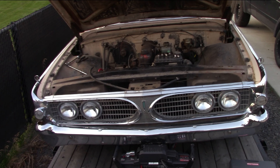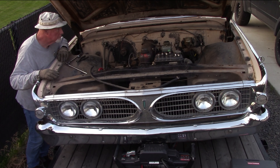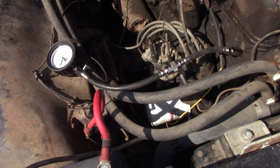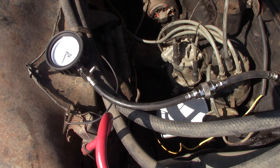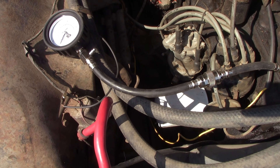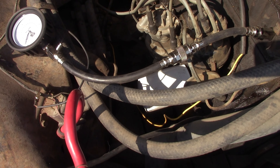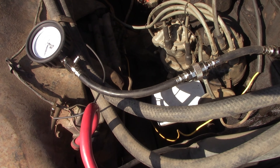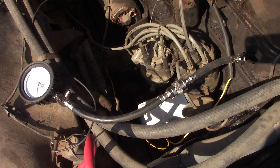I'm sure the car was running good, but I don't think it's been run like we've run it this last weekend in a long time. I think it was just putted into Colville and back home — not wound out in second gear going up Big Sandy. Before we get carried away on the fuel system, I'm going to run the compression tester across the cylinders and see what we've got for readings, just to make sure we don't have a dead hole somewhere contributing to our problems. Let me find my dad and we'll commence to testing.